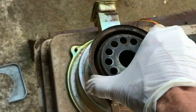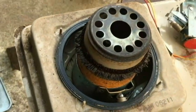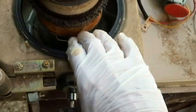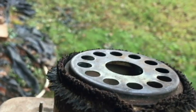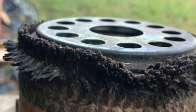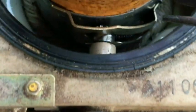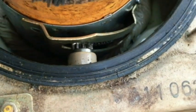It comes right off. You can kind of get an idea that it actually goes underneath like that at the front. So now there are four wing nuts I need to remove. When we lift this up we should be able to see the wick if there is one in there. There it is. It is working, looks like. For some reason I could not get it to move — it doesn't seem to go up very high. So to remove the wick I'm going to start with this little cotter pin right here. Pull that off. See how now from the knob we can pull that away — that gear.